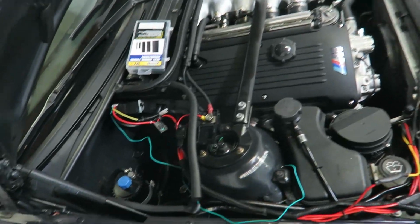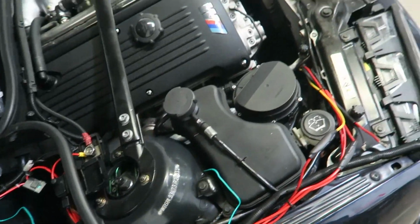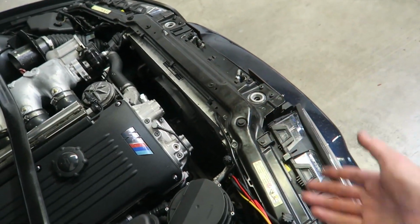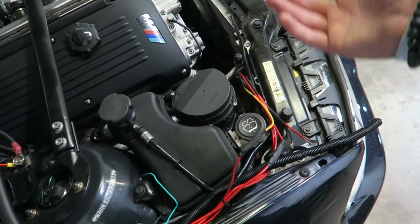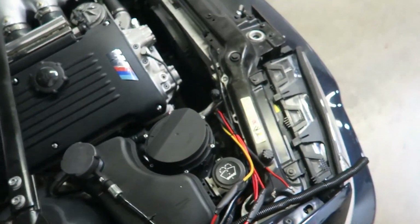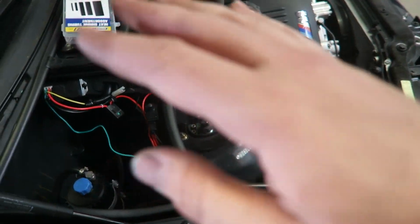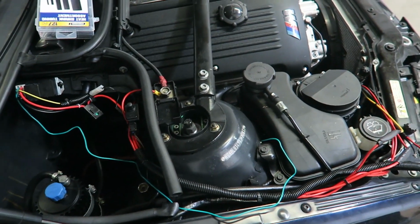All right, to my dismay, it looks like I am going to be having to run 2 relays. Having 2 fans wired to the same relay was too much, unfortunately. So I will be installing a second relay, pretty much the exact same process, guys. I'm not gonna bore you with everything all over again. So let me check in with you when I have the second relay going and I'll begin the testing process.